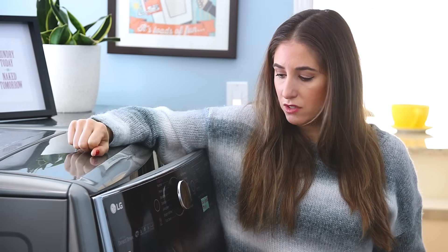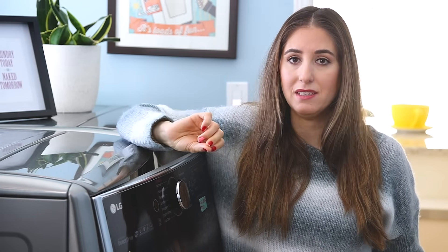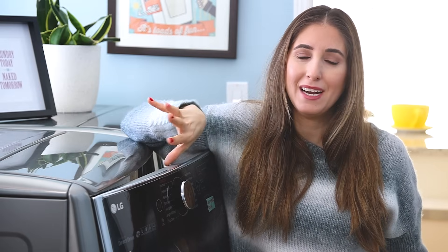The real boss of the heavy duty cycles is the allergy cycle or the sanitizing cycle. You would want to use this if you're a healthcare worker, if you work with pets, if you use cloth diapers or have a child potty training, or if there's any reason you'd want to kill germs, viruses, or bacteria in your laundry. Keep in mind the water has to get up to 165 degrees Fahrenheit — it is hot! So make sure the items you're washing can withstand that temperature. The benefit is you'll pull it out sanitized, and your machine will be nice and clean for the incoming load.